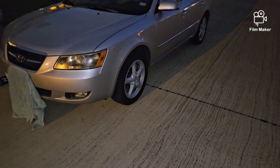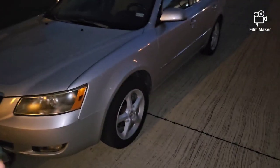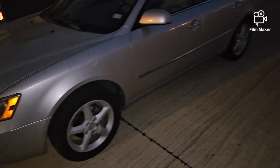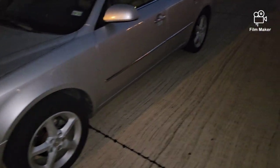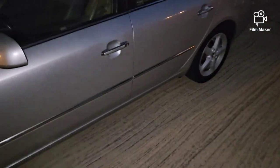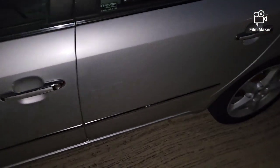This is just adding to the video that I did earlier, and this is showing that the headlight switch actually took care of the problem that I was having. As I explained in the early part of the video, a multi-function turn signal switch has a headlight switch, the fog lamps, and of course the turn signals and the bright lights on it. So when I cut it on auto, the automatic headlight feature would make my inside lights flicker.